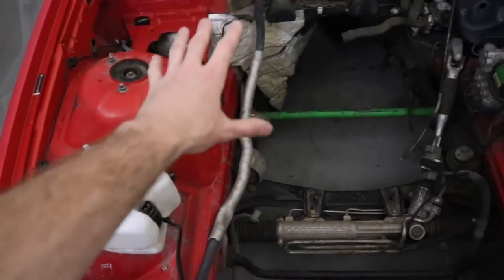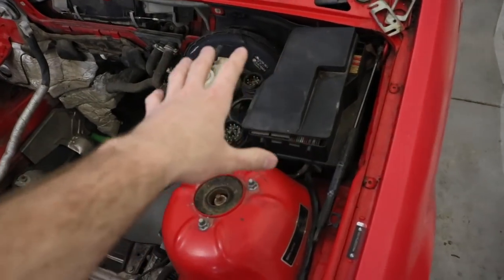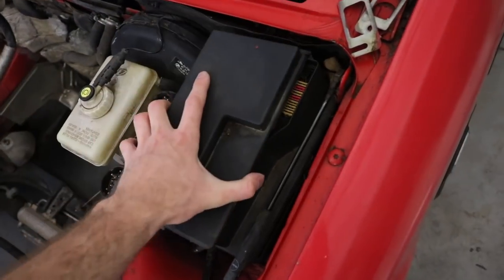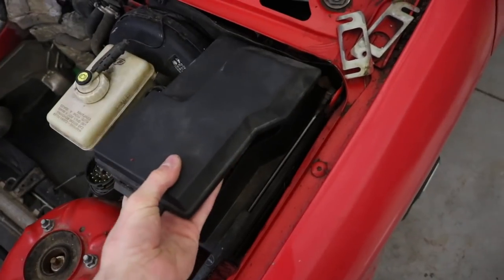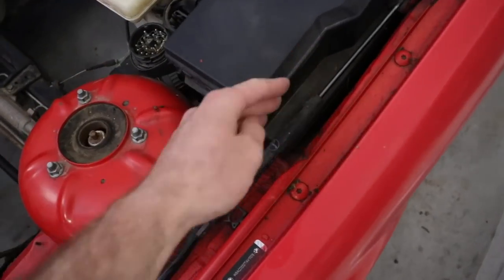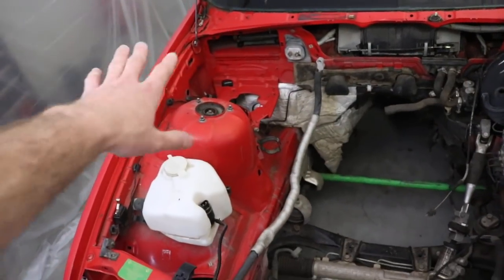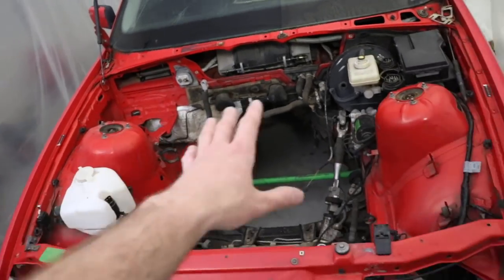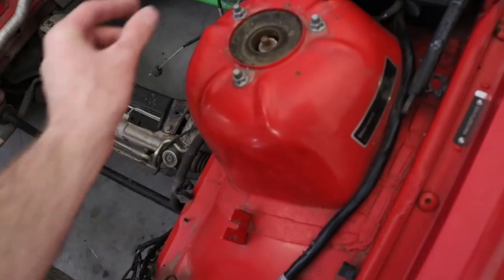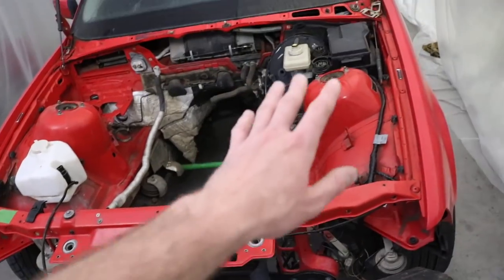I've never done paint like this before or any body work, so I've had to call some people and ask for advice. I'm going to be removing a lot of stuff out of the engine bay — the AC line, the reservoir, the brake booster. I'm going to leave the fuse box in because it's absolutely a pain to take out and I'm afraid it would never go back in the right way. I'm not too concerned about it being 100% perfect, so I'll just be cleaning it up and taping it off. I'm going to scrub down every single nook and cranny of this engine bay, then get a scotch-brite pad and start scuffing it up before masking and taping off the little things that stay in place — then we get ready for paint.